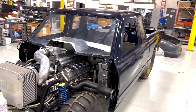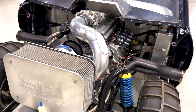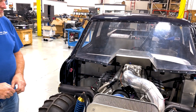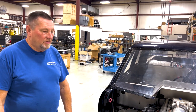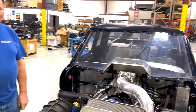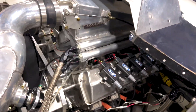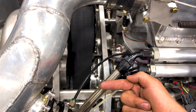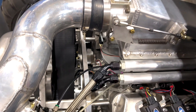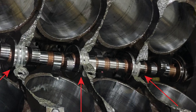Gary ran it here a couple years ago. We finally got the engine all sorted out for him, and one day he says the thing has slowed down. I asked how much — he said terribly, he wasn't driving anymore because something was wrong. So he brings it to me. I start it up, unload it, I'm checking everything out while it's running. I rev it up a little bit and I see the crankshaft pulley going forward and backwards, and I go, oh my gosh, something is really wrong with this thing.